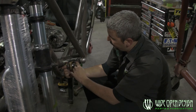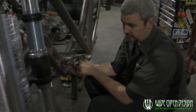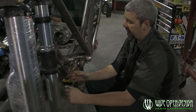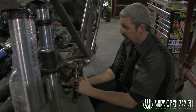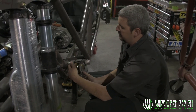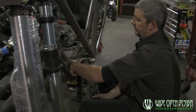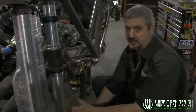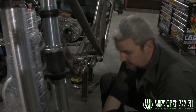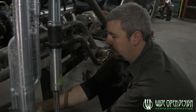You've got all your tabs put on the chassis, they're in line, you've strung them up - now you need to get that measurement that's going to be your link bar. A lot of people at this point like to put a little bit of PVC in there or use different things to help them visualize and get a checklist going. But when we're ready and trust all these measurements, we're ready to get that link measurement. Put your heim joint in each mount that it's going to.